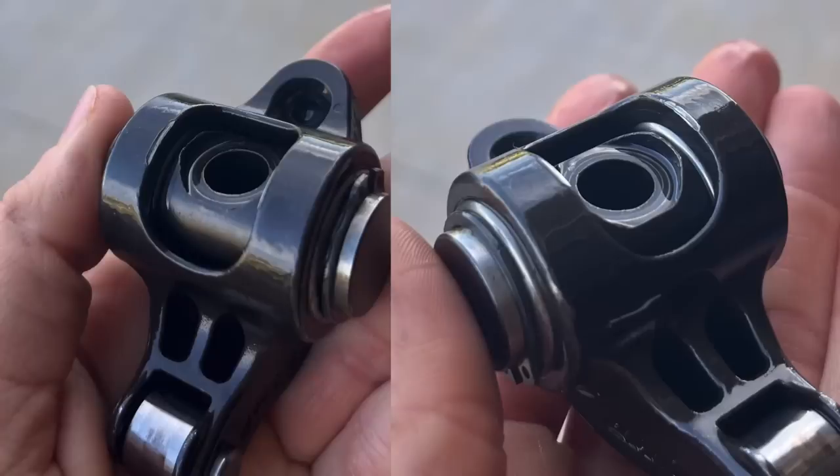Let's get right into it. I got schooled on pushrod and rocker arm geometry, and I failed when it came to measuring my pushrods. When we took off the rocker arms on cylinder one, you could actually see the grooves — the studs were rubbing into it, so obviously that was a huge issue. One of the valves was definitely being hung open, because since the pushrods were so short, when we went to do the half turn after setting zero lash, it would just push the spring down already and hang the valve open all the time. If you want to watch the old video of how I measured my pushrods, technically it's not the incorrect way, it's just not the exact way. I would recommend doing the math versus the feel method that I did.